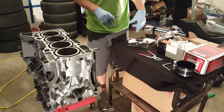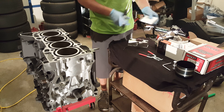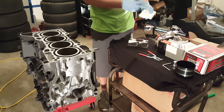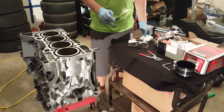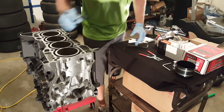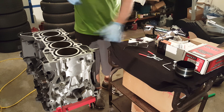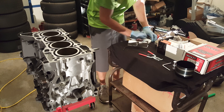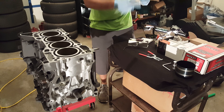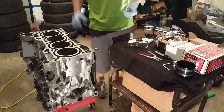I'm going to go ahead and label all these little boxes of rings. These are the Wiseco ring sets, all in one. I'm going to label them one, two, three, four — starting with this being one, two, three, four on the timing chain side, that's which way I'm going to go. Because when you gap them, you're going to have to gap them per bore.